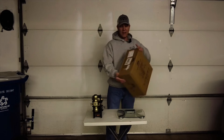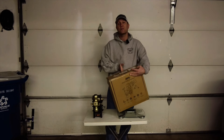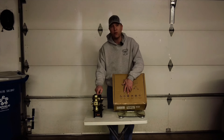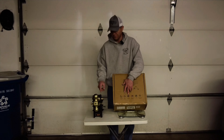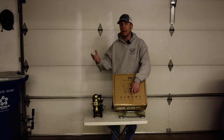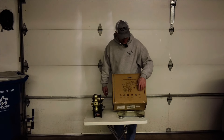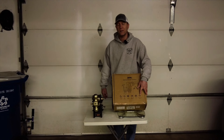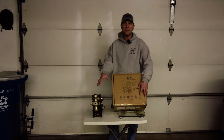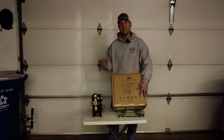Quickly, on the box it's stamped everywhere: 20,000 gross trailer weight on a 2-inch ball, 25,000 pounds on a 2-5/16 ball. I'd like to point out this is a forging ball mount — it doubles the towing capacity. I'm not exactly sure how it does that; I think your truck is going to regulate that. But it also has intelligent robot welding, and we're going to take a look at some of the welds and the gusseting and what reinforcing is on this hitch to make it rated for 25,000 pounds. That's a lot of weight.